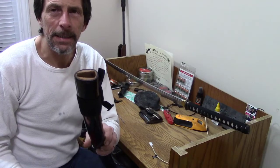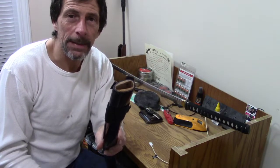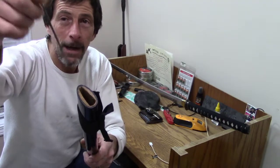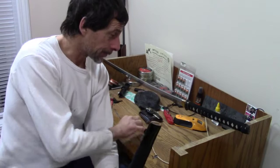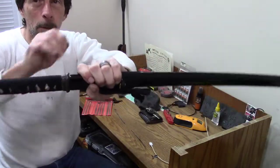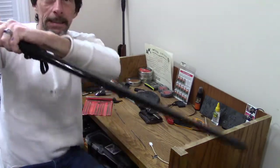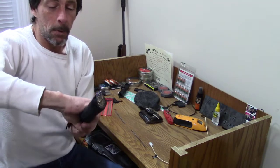So I could use wood glue. I used a wood glue and glued that little shim in there. It's been about a whole day and a few hours and it's dried. I tried to put the sword in and it was so tight that the habaki would stop, so I had to take the file again and file down the shim some more so it's really really thin. But all in all, the sword goes in and it does not fall out at all. It's pretty tight — it takes a little effort to break it loose, but I figure it will wear in the more I take it in and out.